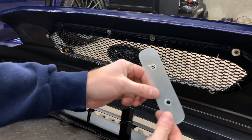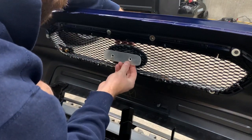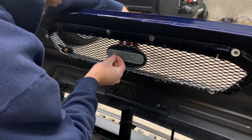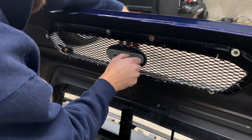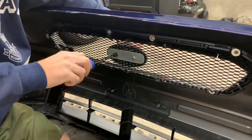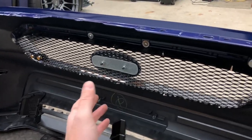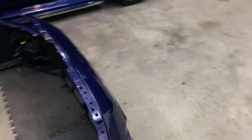As you can see the little screws are sticking out the back — this is the bracket and hardware you're going to use. All we're going to do is slip the bracket over, take a washer, another washer, and screw it down. These are nylon locking nuts so they'll definitely stay tight. One thing to know: don't overtighten it. This is metal and this is fiberglass, so you can crack things if you over-tighten. You want it firm but nothing crazy tight — it's not going anywhere, it's super secure.